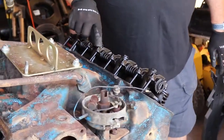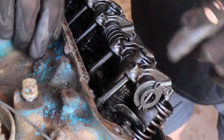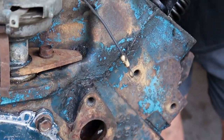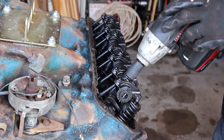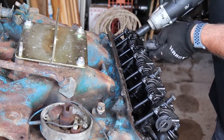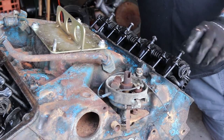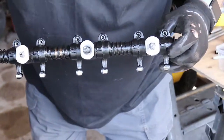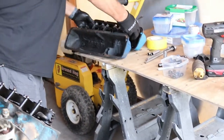Next, take the rocker arms off. The reason you take these off next is because the push rods go through the intake manifold — if you look, you see where it splits, that's the intake. So these have to come out. What you want to do is keep these together, don't take them apart. There we go — that boy is loose. You leave the bolts right in the rockers and lift this right up. For being a 1966 motor, that's in excellent condition. Set this baby right in the valve cover so you don't mess anything up.